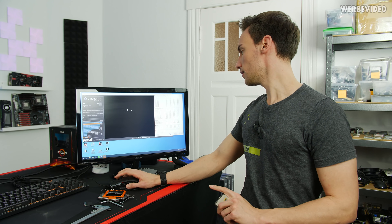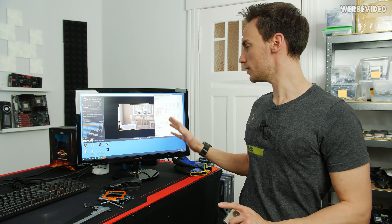This is already attempt number three — I've remounted three times. The first time I had 00 on the debug LED. The second time I had memory detection issues where one DIMM wasn't detected correctly, which is typically an indicator of insufficient mounting pressure. Third remount, everything is posting fine and we're now in Windows. Running Cinebench, temperatures are now going to 83, 84, 85 — towards 86°C — which is pretty much the same as stock. This is likely related to not having enough mounting pressure, which is also probably why we had the boot issues and memory detection problems.